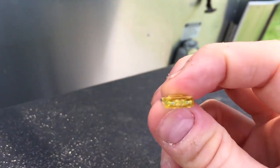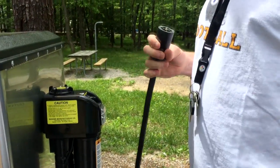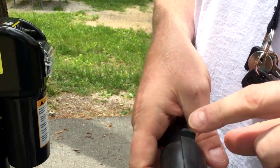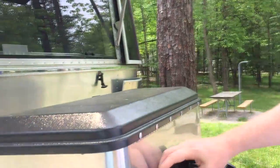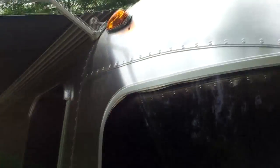What we were shown was: take a fuse — in this case he actually gave us the fuse — it's a small 20-amp fuse. You grab the line that goes into your truck, take the fuse, and bridge it across the two contacts right by the little lip, the alignment tab on the connector. You bridge across it, and as long as you connect it to shore power — or actually it doesn't really matter, shore power or whatever — it runs the lights off your batteries.